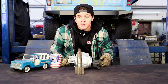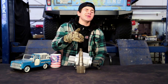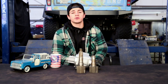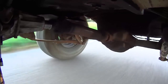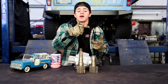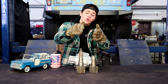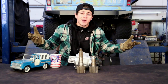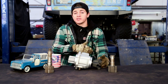And why isn't it going to cut it? The answer is axle wrap. Axle wrap is one of the most common culprits that causes your output shaft to give out. It's a term used to describe your axle housing being rotated by the torque applied to the pinion gear. This process puts a lot of stress on the components of the differential, drive shaft, and transfer case. When you put an old, stressed output shaft into that situation, the likelihood of that part breaking is high.